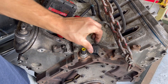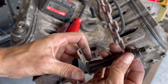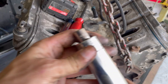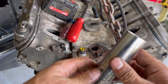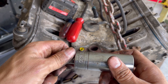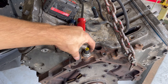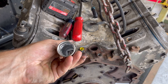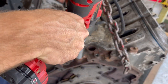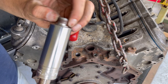These things can be kind of a pain in the neck to break loose because you're pulling on the side, so it's always creating a side load. Once you get them busted past this ring, you're good. We're going to pull out the oil pressure sending unit. To do that, you want to get a socket just like this — you can get it from AutoZone for about $10, but it just makes your life way easier. There's not a whole lot of room to put a wrench on this thing, so you pretty much have to get this socket. It's the only way to get it out.